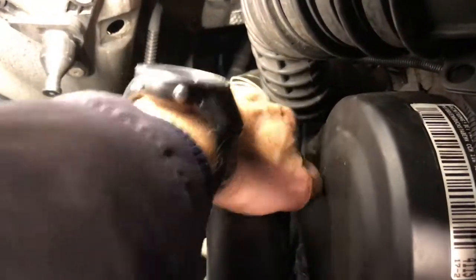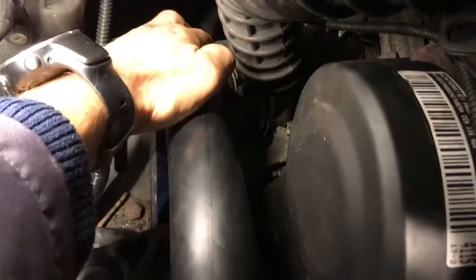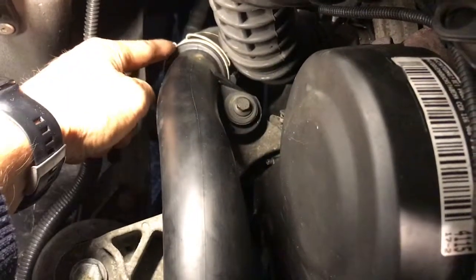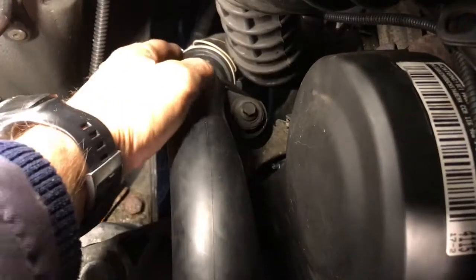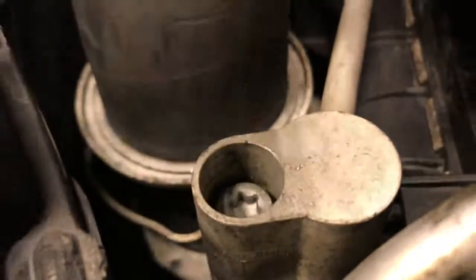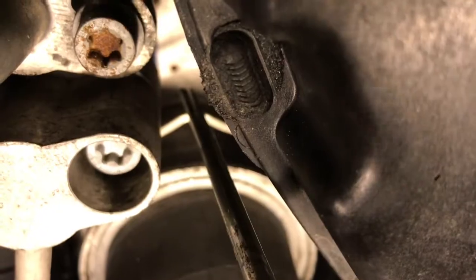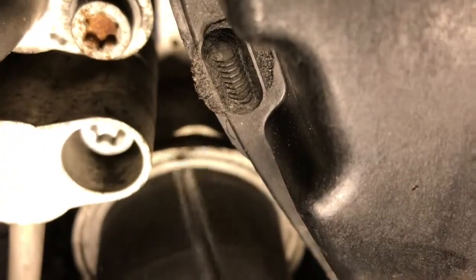There's a 10 mil bolt there that goes in there. That spring you push back in. I just put some screwdrivers in there before to lift it up, and then I turned it round. You push those clips back in again, and then on this side, just make sure that that's in nice and flush there on the edge, and then we can push that clip there back in. So that pipe's all locked in there.